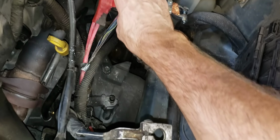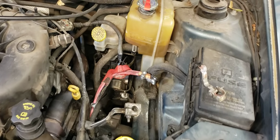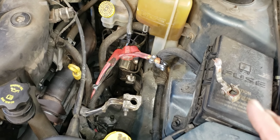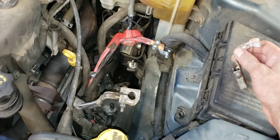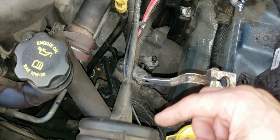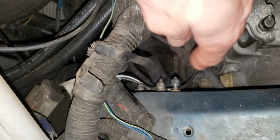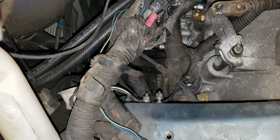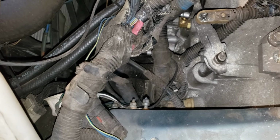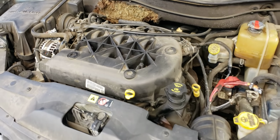It was covered up by this rubber boot, and these wires were completely plugged. So anyhow, it shut the customer down. The tow truck driver couldn't get her restarted. I had a hard time restarting it, all because of a corroded battery cable. I then went down underneath and checked the negatives. There's a bunch of negatives on the frame right in this area here. See these posts here? I cleaned all those up because I thought maybe it had broken a negative post on the frame or on the transmission. They seem to be intact. I checked the starter, and that's what I've come to realize. I was able to then put a battery in it and drive it in the shop, which I haven't been able to do for the last couple days as I've been scratching my head.